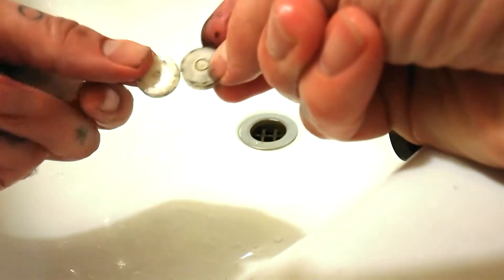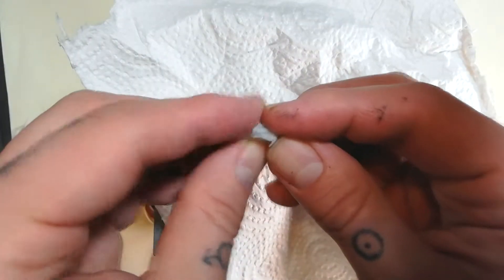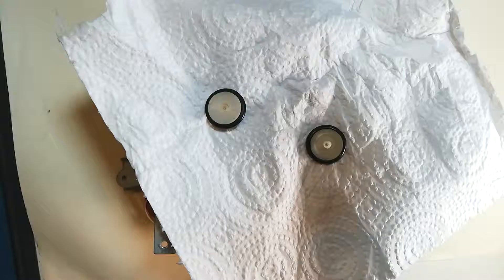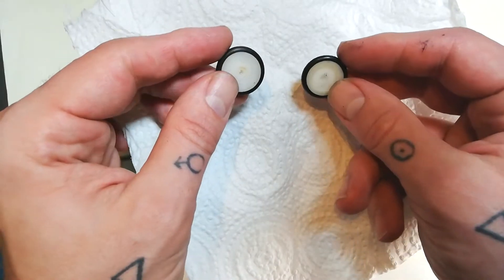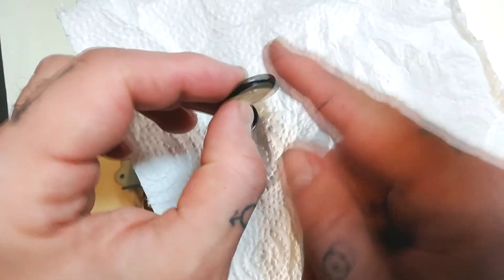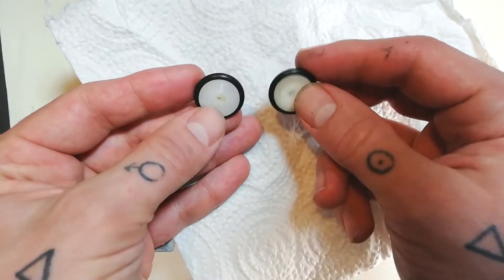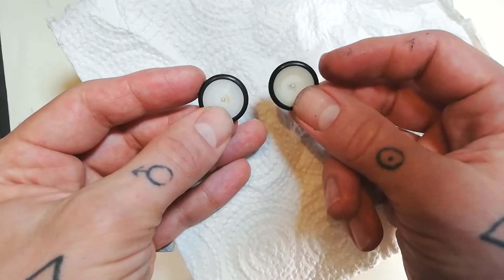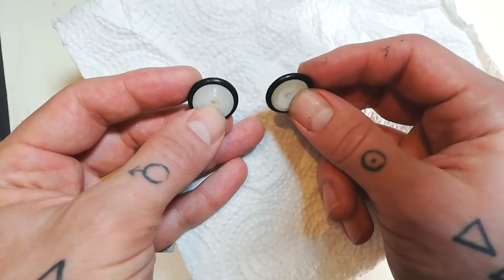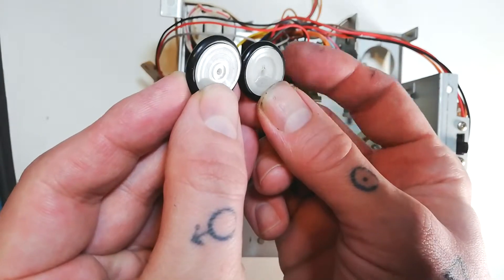Get the last of that residue off with the isopropyl swabs — get the last of the residue of the old idler tires off. So I'll get my new belts, slip those onto the wheels, and they're ready to reinstall. You might notice that these idler tires look a bit big and a bit round — I'm actually using plumbing parts and then filing these down. It's just cheaper than spending a lot on a kit from eBay. I'll show you how to source them in another video. But let's assume for the purposes of this video that these are the prefabricated ones you've bought online and they're already the right size. You can see one's got a textured surface with ridges like a record and the other one is smooth.